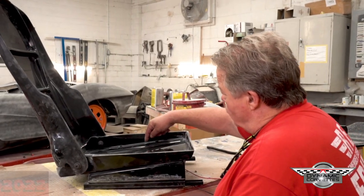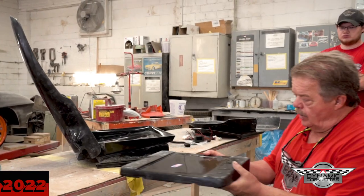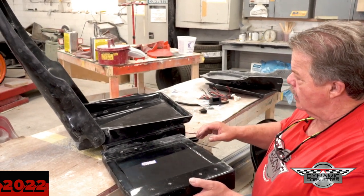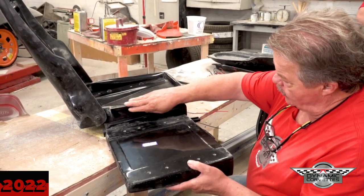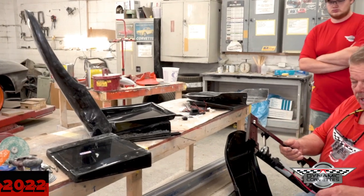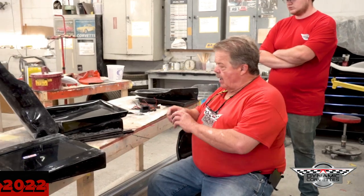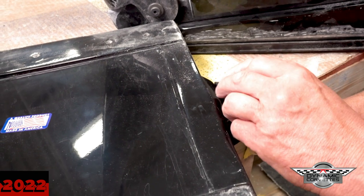In the bottom of the seat you'll see where there are added holes. This plate of the seat is our base — the anchoring part. You're going to have two bolts on either side to anchor it, but we have different positions, so you can move the bottom of the seat on the seat base. You have a nice heavy-duty power seat track that takes you front to rear — that's all that seat track does. And in here is your power switch.